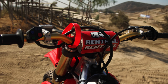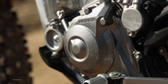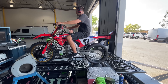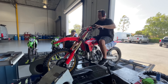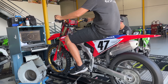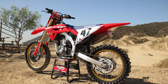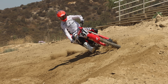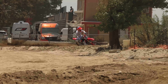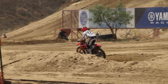The 2023 CRF450 rolls on super smoothly and super crisp, which is exactly what you're looking for when you spend big money on a fuel-injected four-stroke. All four MXA test riders preferred the 2023 power feel over the 2022 model. Once we got it on the dyno, we could really confirm what we felt on the track. The 2023 Honda 450 is considerably slower than the 2022 and 2021 models. The 2022 peaked at 58.2 horsepower; the 2023, with its smaller throttle body, longer intake, narrower intake funnel, and muffler changes, dropped to 56.8 horsepower peak in map one — over a full horsepower difference. This new bike is a lot more mellow and smooth, and definitely doesn't have the wide-open high horsepower it had last year.